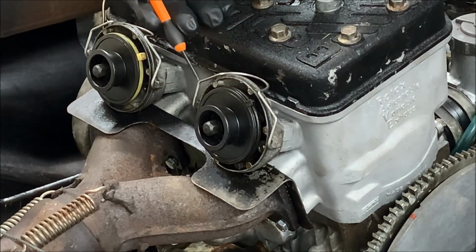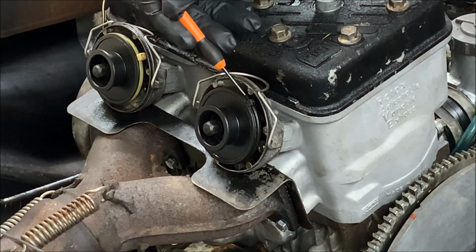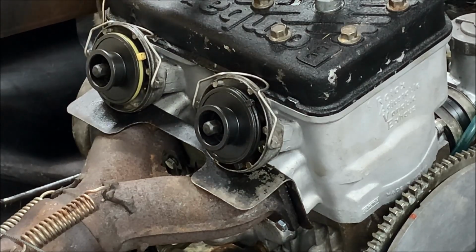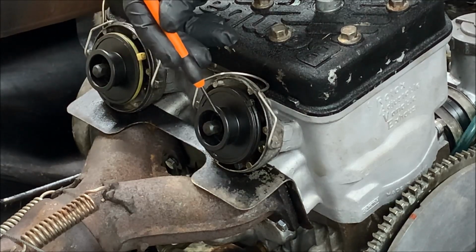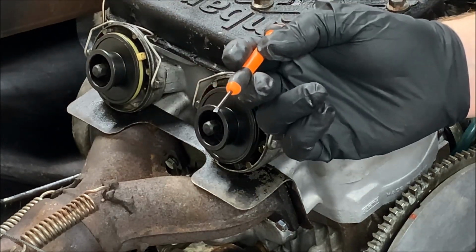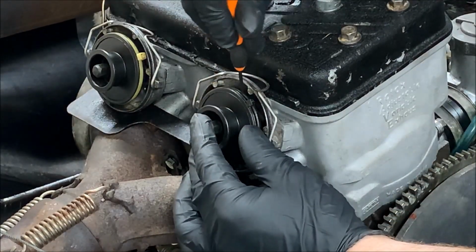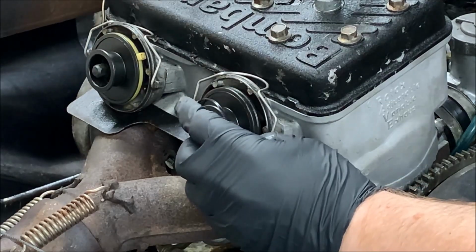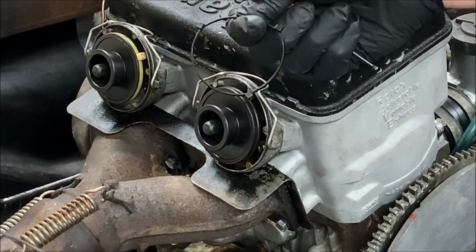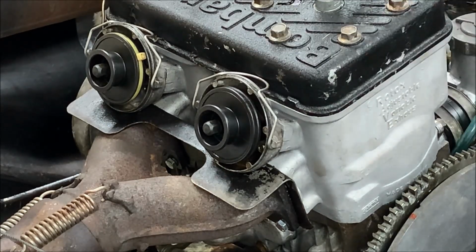So what we need to do is separate this front part of the valve from the back. We're going to very carefully remove that ultra important zip tie, so then we can unscrew this part of the front of the valve and pull it off. I'm going to use a micro screwdriver to get underneath it, and again I'm going to be very careful because I do not want to break this thing, and I'm just going to put it over the edge. Comes right off. And if you look, somebody has already replaced this with their own improvised version. It should not be three zip ties in one. So we're going to put that to the side.